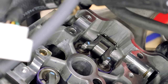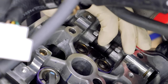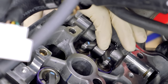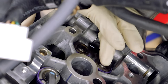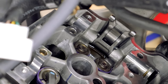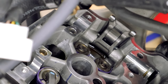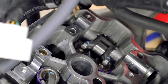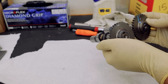With the cams out, there are a few components I'd like to point out while we have this all open. The cam lobe turns here. Instead of pressing each valve directly, it hits a rocker in the center — there's an actual bearing that the rocker rides on, with oil shot everywhere. In fact there's a squirter that puts oil directly on this roller every time it goes around. We can actually rock the rocker up out of the way, and right here on the very top is your shim. That's going to be important later when we adjust these valves. The easiest way to remove a shim is to come in here with a strong magnet. There's a little number on each shim that should tell you the thickness, but you should always double-check by measuring.